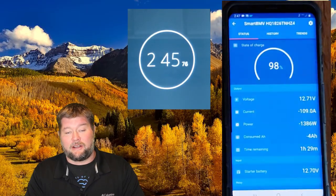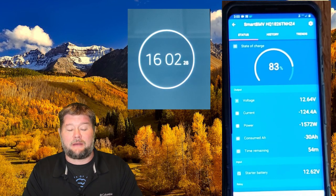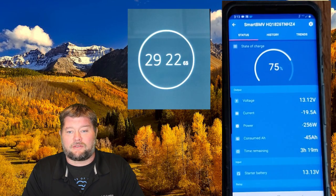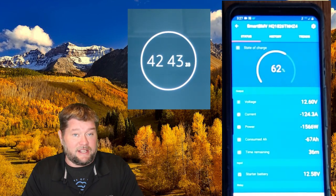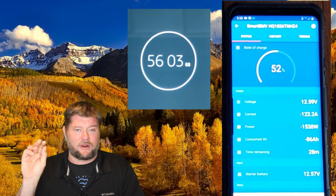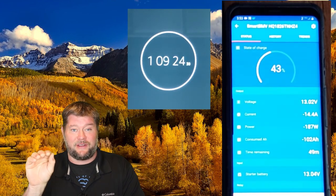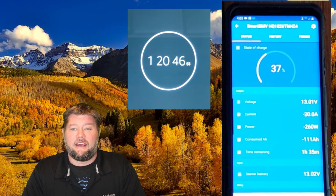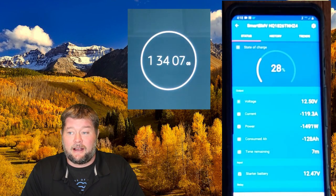It's going to be going from about 300-400 watts with just the fan, up to 1,500 watts when the compressor runs — that's about 125 amps, which is a lot of power to run an AC off battery. What's really cool is that with the Easy Start 364 we don't have that huge surge. In my previous test without the Easy Start it would surge up to about 2,800 watts for a second and then drop to 1,500 watts. With the Easy Start it just goes right to 1,500 and stays there.